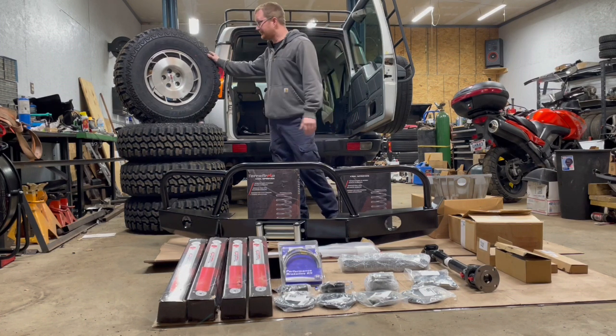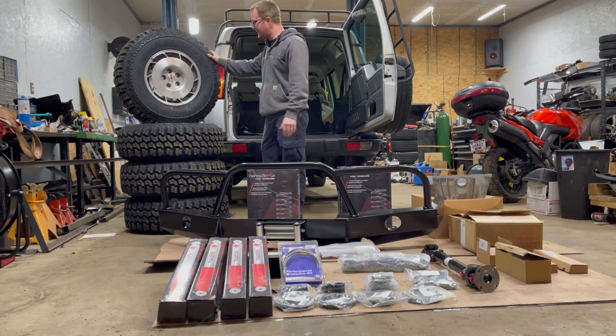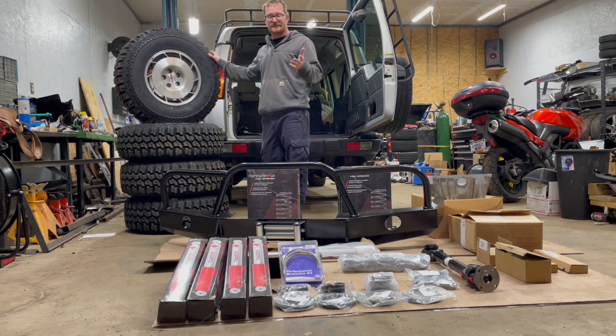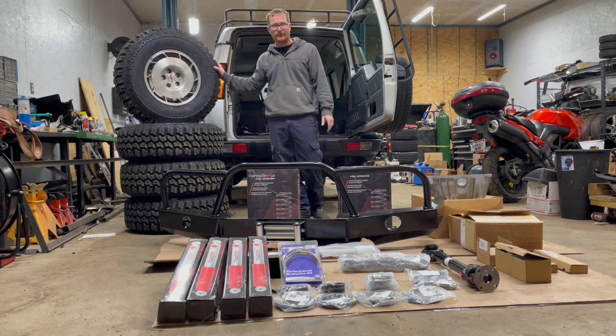This is kind of neat. This is a mid 80s Corvette wheel. Land Rover shares a bolt pattern with BMW, Chevy, like S10s, Corvettes, Camaros. It's a 5x120, and it's kind of a strange thing to find wheels for. Unless you buy a brand new set of wheels that are drilled for a 5x120 bolt pattern, you're not gonna find much in the aftermarket world.